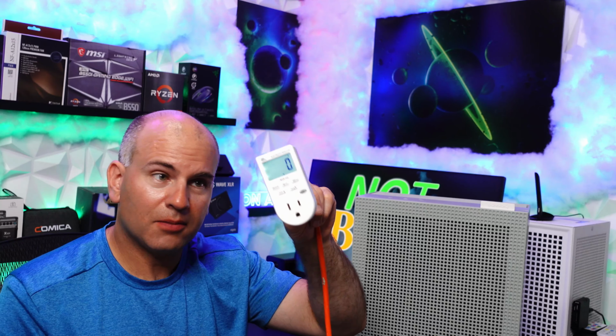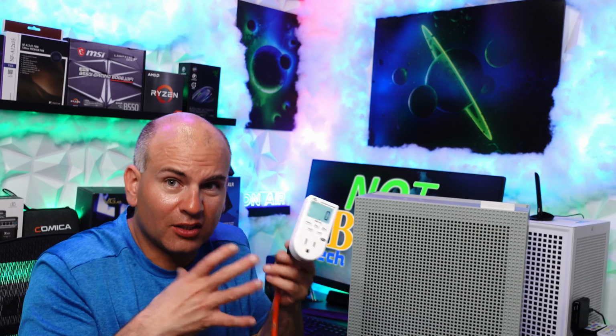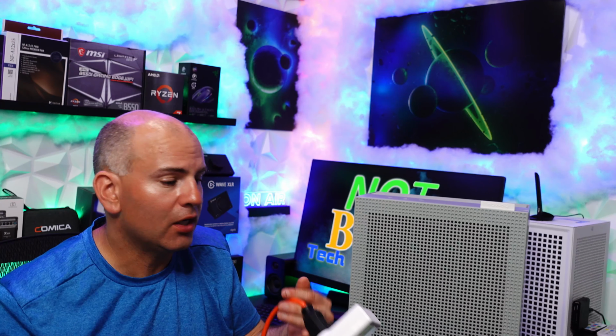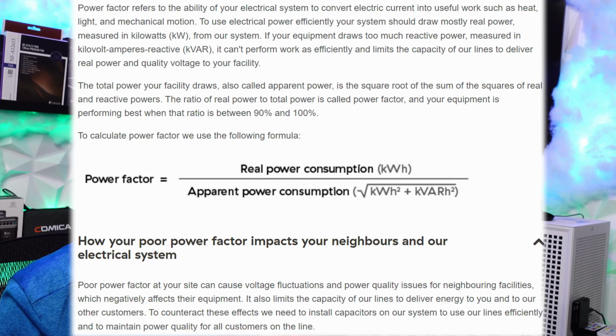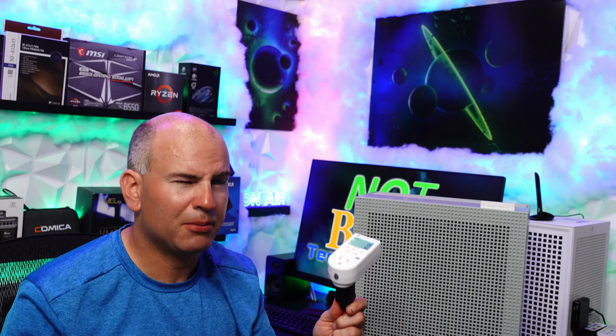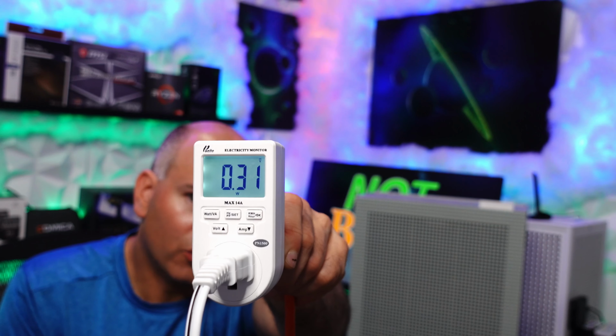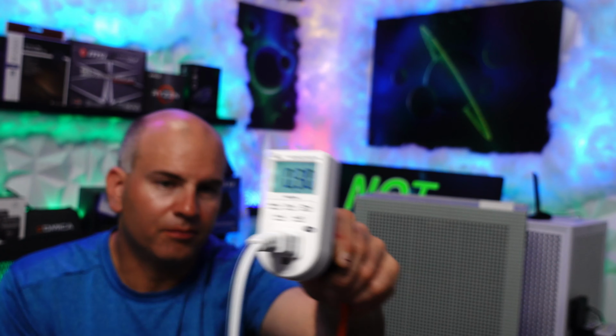One thing we want to test is the power factor and the VA to see actual power usage. It's not that it uses more power, it's just off-axis power, and it can cause a higher electricity bill, which I showed in my YIOU air purifier video: here in BC, Canada, you pay more if it has a bad power factor. But that one actually has a pretty good power factor. I had a purifier, the Malap JK150, and it had a poor power factor. So not doing anything, we are using 0.3 watts, but now I want to check our power factor.